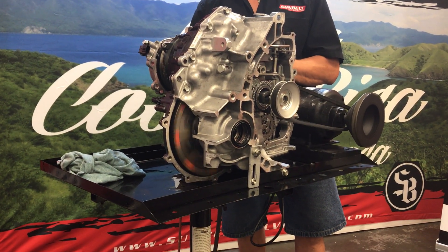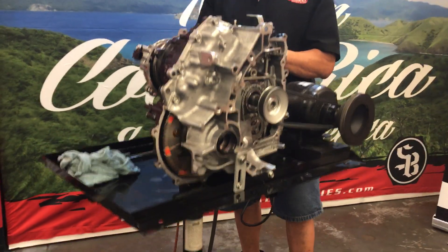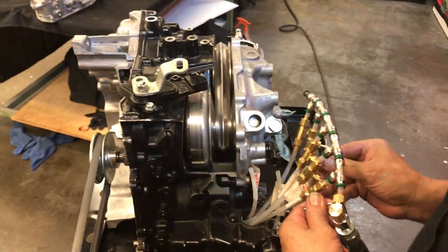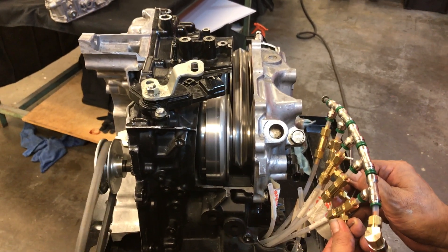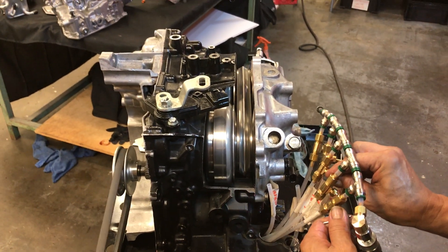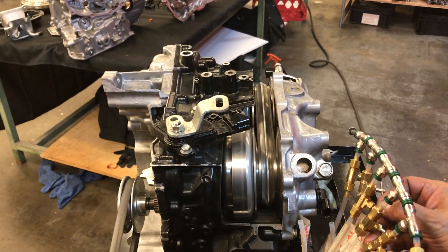I'm going to engage the forward and do the primary test one more time. This is your A solenoid adjusting on the valve body — it's starting to bring up the pulley, coming to full ratio. I close it, your B solenoid comes in. There's the operation back and forth of the variators: air being applied, full ratio, and ratioing it back down.